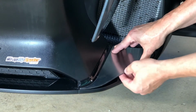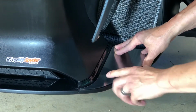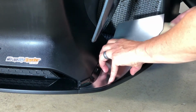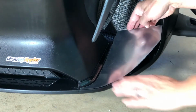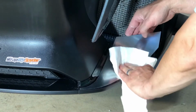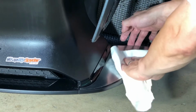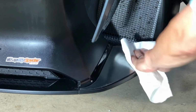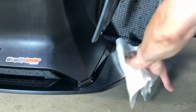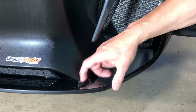And then what you can do is tack it. Now once you get, I don't know, 2.5 inches up, you can reach underneath. Now it's pretty much going to fall in place. So peel back the rest of the backing. When you're installing this material, you want to make sure that you're pushing it down as you go. That's kind of important. So you could even use a rag and rub it down, and then keep it in the air on the backside, but push to it. And then it's, of course, going to fall right into place. And this is going to help you to prevent trapping air bubbles in the material, making sure that it's laying nice and flat. And like I said, it'll fall right into place where it needs to go. So that's nice and flat, tacked very nicely. It's not going to go anywhere.